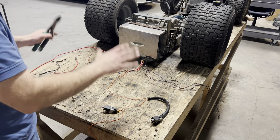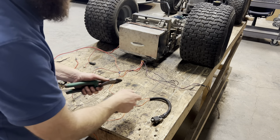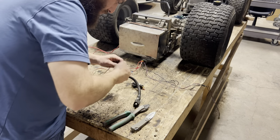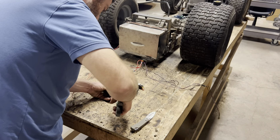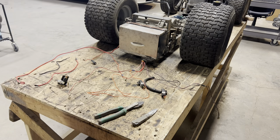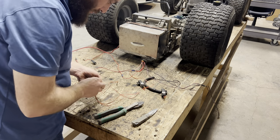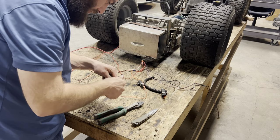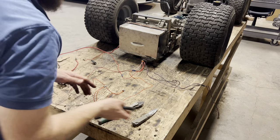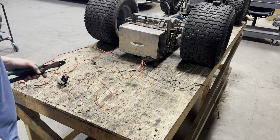All right, all the yellow wire is out of the way. It's already looking a whole lot cleaner. I'm going to clip these orange wires close to the switch, strip them down, twist them together, and bypass the switches. I'm going to put a couple little baby wire nuts on there just to help keep it true. This is not a permanent fix, but it will help us get everything organized and planned and laid out just the way we want it. All right, now we're at a good point — minimal wiring here.